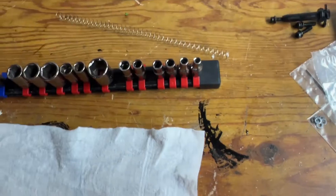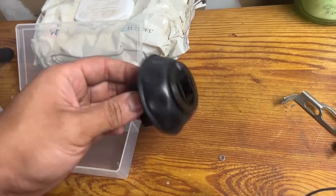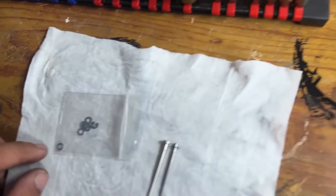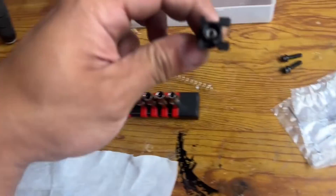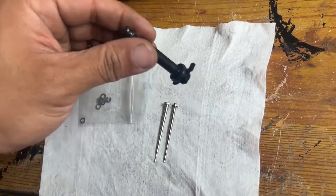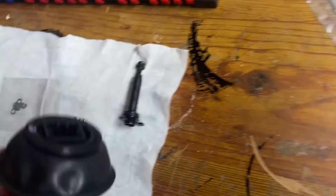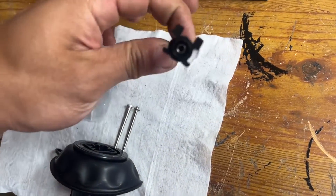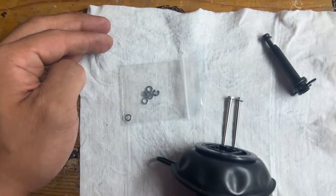When we tipped the diaphragm down earlier, this washer came out — that washer actually stays down there upon reassembly. They've got a second set of washers to go on top of the needle to press up against this piece. So reassembly is basically the reverse of disassembly: diaphragm piece in, washer inside, needle in, another washer on top of the needle, and then slap the cap back on. Pretty simple.